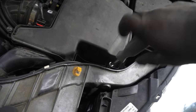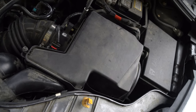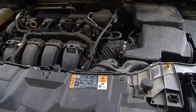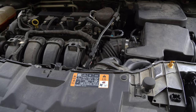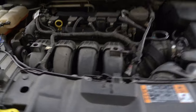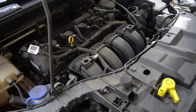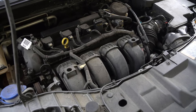Sink these screws in — remember it's just tying into plastic, no need to go he-man, just keep it nice and tight but not over tight. From here we're going to start it up — it might have a little bit of a rough idle only because I just cleaned the throttle body. Sounds good — started up first time. When it didn't have the actuators done, she wouldn't start at all. Now that the throttle body is clean and I have new actuators in there, sounds great. Anyways, I hope this video helped you out — like if you did and subscribe for more.